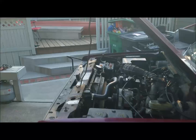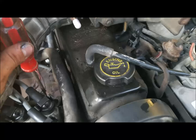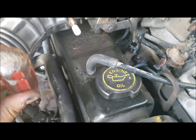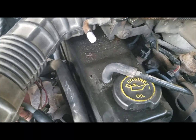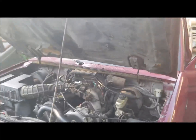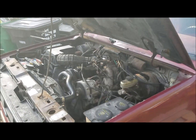We plugged that coil in and the hot truck fires right up. Now we're going to go around and unplug our primary ignition coil — the previous owner already broke off the other tab, which makes it pretty easy. Now we see we're running off only the driver's side ignition coil.